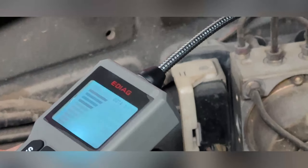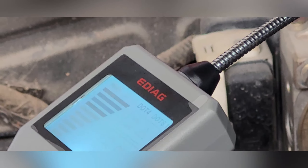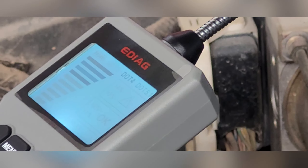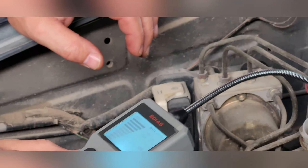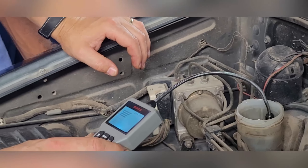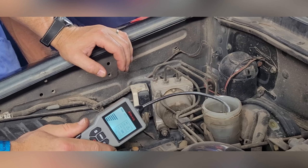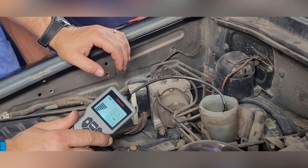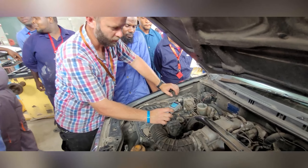And as you can already see, the brake fluid in here has above 2% water content, which is not so good. Also in the color of the brake fluid you can already see that the brake fluid is pretty old, so the recommendation would be to change the brake fluid to a better one.